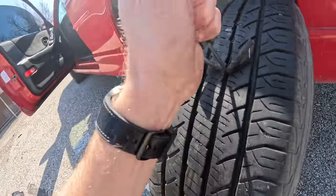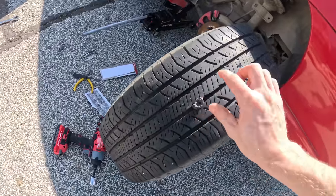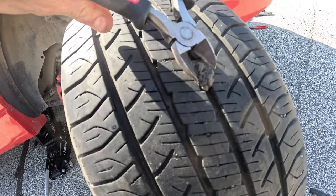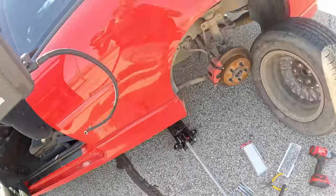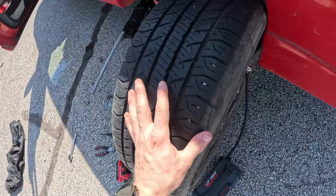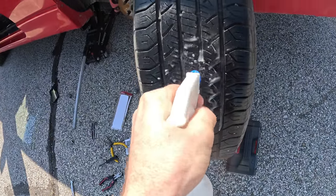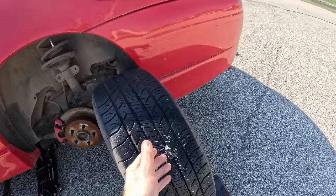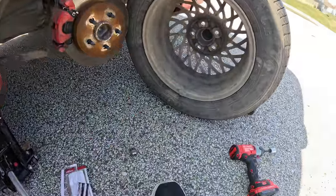I might need a hammer to get it in. Now that we've got them in there we're going to pull this out really quickly and it just leaves them inside the hole with their little gunk stuff. We're going to cut the excess off and this is a fully repaired tire. Some people will tell you it's temporary but it's fine — I promise. We'll pump the tire back up and prove that it's holding air. She is inflated. Now let's actually test to make sure the hole isn't leaking anymore. I don't see any bubbles coming out. We did it! Now we'll just have to see if it actually lasts. It's possible the road will cause it to get pulled out, but I'm pretty sure this is good and it costs $7 rather than the $150 it would take to replace the tire.